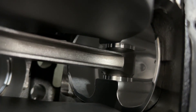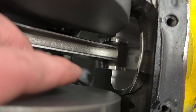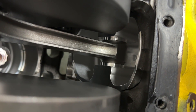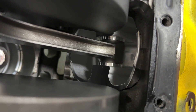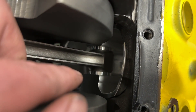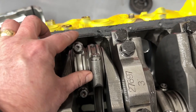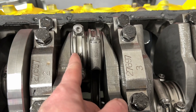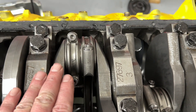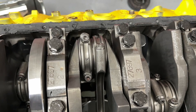This is what most NASCAR high-performance engines use. It's a little tricky — you can't just put it on anything. You have to have the pistons machined flat because there's a flat washer that goes there and it has to seal against them. Usually they're left kind of rounded — that won't work. You have to machine them flat. It does take more time for assembly because each one of those you're going to hand file or sand to get the right clearance of 6 thousandths. The benefit — you might wonder if it messes up oiling. Actually, having more clearance here lets more oil come out and cool the rod, so the rod stays cooler because there's more oil flow. The downside is that because there's more of a gap, more oil can get out, which creates more windage — so you've got to address that.